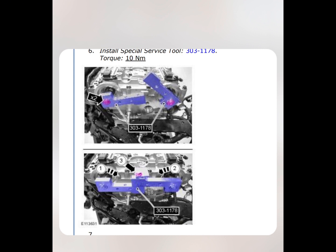What you're supposed to do before you torque these bolts down is to unlock your cams at this position and then torque the bolts down. This is so that you don't bend a valve. Now, I didn't unlock my cams when I torqued it down because I really struggled to understand why I needed to do this. I talked to some mechanic friends of mine and they told me that I should be fine. And lo and behold, I left them locked and I didn't bend any valves and it was fine. But I just want you to be aware that this isn't the Ford recommended way to do this. And the method for correct install is in the description below. But again, this is the way I did it and I didn't have any issues.